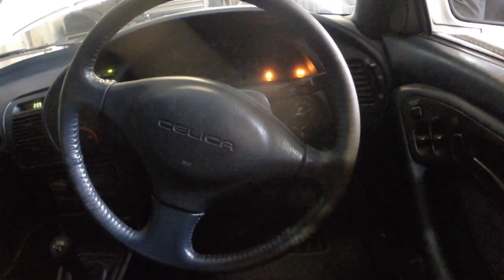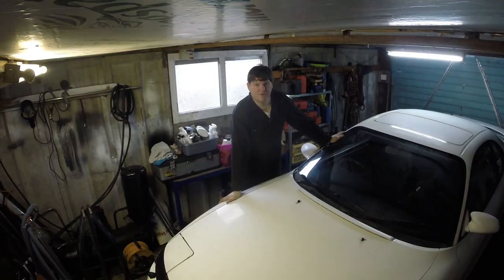But we've eliminated a dirty pickup ring. So that's gonna be it for this particular video. We've eliminated problems with the pickup for the ABS sensor. So that's one area eliminated. So it's either the sensor or the wiring that's the cause of the open circuit. And then Albert should be able to get that ABS sensor out if it needs removing.